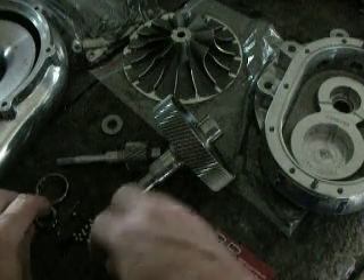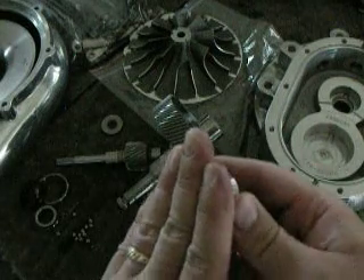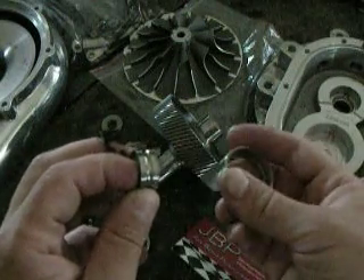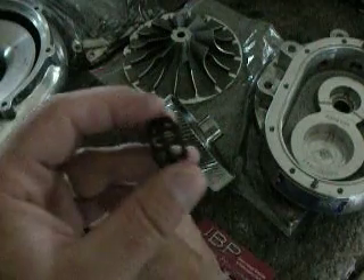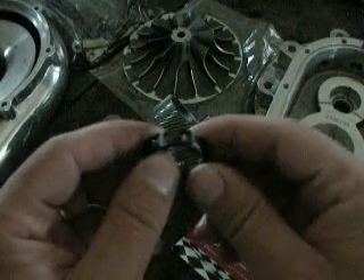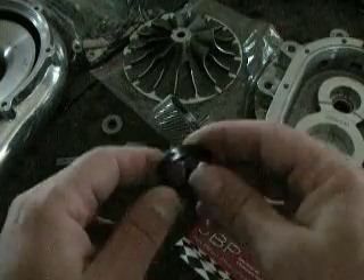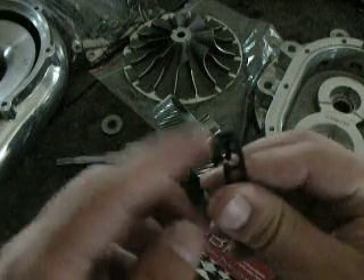This is what I found. A normal angular bearing that goes in these looks like this — a lot of times people make the mistake of just buying a normal bearing; do not. This is an angular bearing and it needs to be a matched set. We'll be offering these on our website. There's nothing really wrong with this bearing, but this other bearing I took apart had a plastic race inside with a little piece missing out of it, and it's cracked and brittle. These aren't supposed to be brittle at all — it's brittle because the supercharger either has miles on it or has run hot. That little missing piece I was unable to find inside the case.